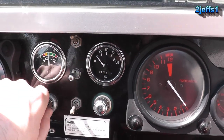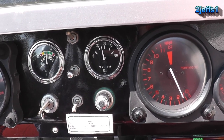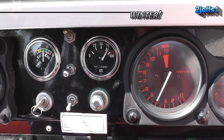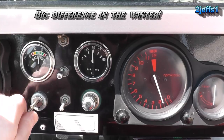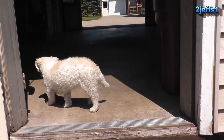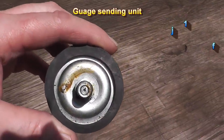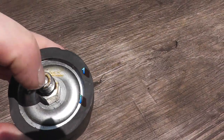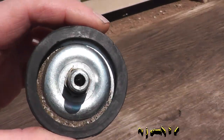Here's a neat little trick: ever notice how fast the oil pressure gauge responds on the go-kart? It's an electric one. I've been doing this for years to make an electric gauge respond as fast as a mechanical one with a quarter-inch copper line going to it. You get that piece of wire out of there that they use as an orifice, then drill that hole out to 1/8 inch — just be careful not to drill in too far and hit the diaphragm. It would be just past that hex head.